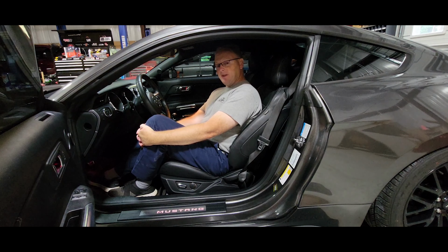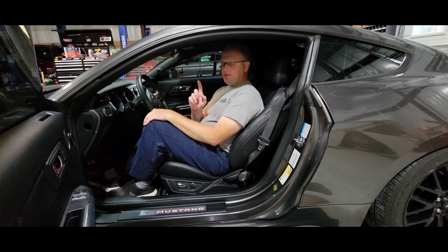And today I wanted to do a short video on ghost cam tunes for the Coyote Mustangs as well as GT350s, GT500s, any of these new modern day Coyote similar based V8 engines offered from Ford. The key secret there is with the variable camshaft technology, or VCT, variable camshaft timing, however you want to use the term. What that boils down to is we are able as tuners to change the timing or the phasing of the camshafts in relation to the piston as it works up and down the compression, intake and exhaust stroke on a four-stroke engine like the Coyote V8.